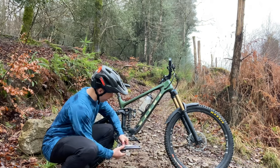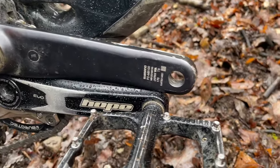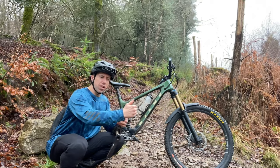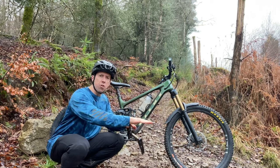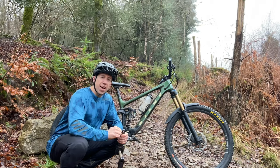When you put the cranks next to each other, there's not much in it — this is 170mm, that's 155mm, so it's 15mm. But when you do that twice, that's a 30mm difference total, so when my feet are level on the pedals they're 30mm closer together.